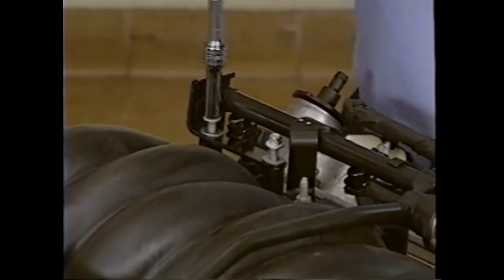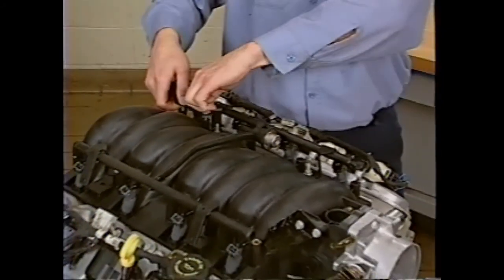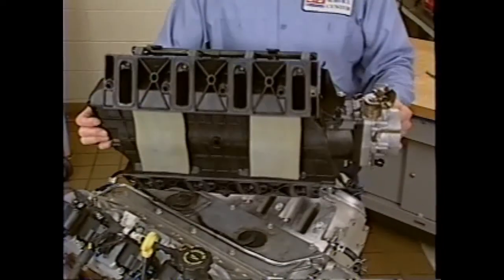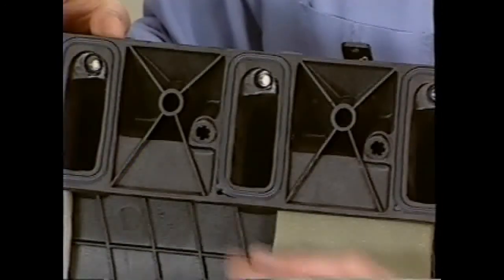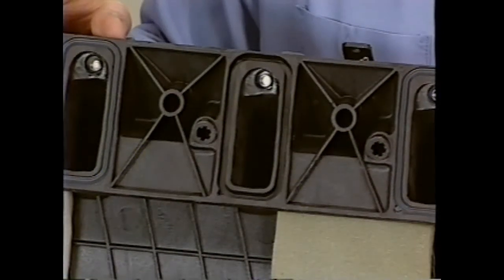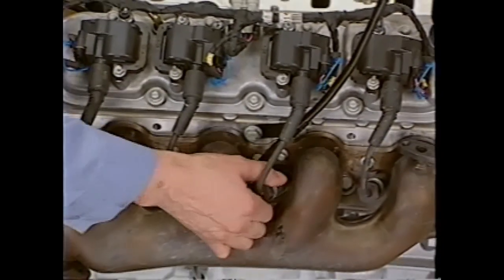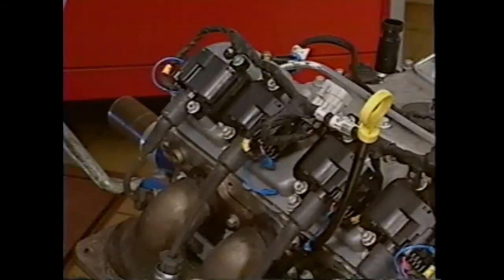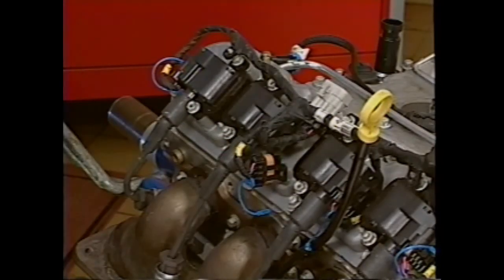The composite intake manifold is designed for operational efficiency and simplified service, as no coolant flows through it. Removal is straightforward. The captured gasket O-rings are designed for easy replacement. Whenever manifold service is required, the gasket O-ring should be replaced. When servicing the coil near plug ignition system, do not remove the spark plug wires from the coils unless coil service is necessary. Ignition coils are serviced individually and are interchangeable.